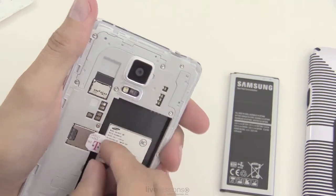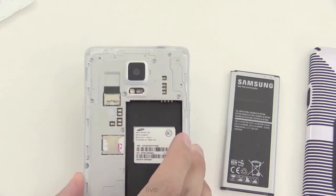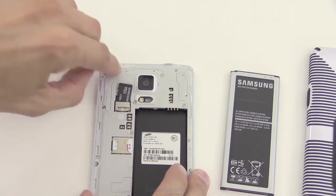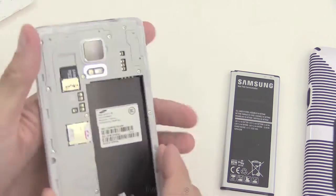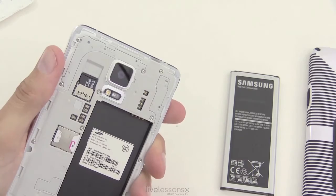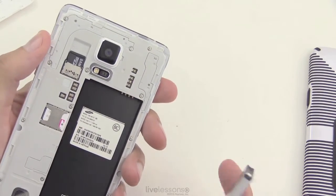The SIM card has all the personal information in it. Snap that back in. We can add a micro SD card right here — let's say I just need a little extra space, so I'll use a 2 gigabyte card. Slide it in. That'll show up in our memory — whatever amount you want, up to the maximum for that device. For this one it's 32 gigabytes, and it has to be a micro SD.